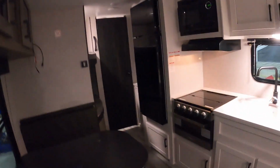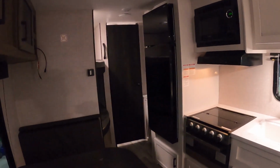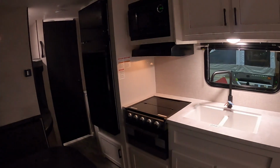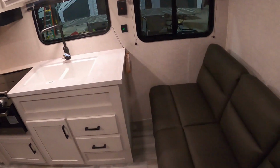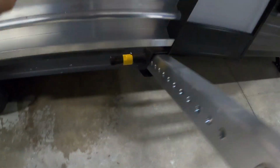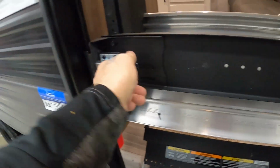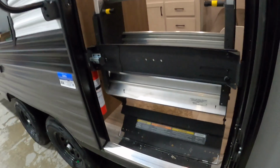But secure everything for travel. Doors and drawers is what I like to say. Go through the unit. Make sure you have all doors and drawers closed and nothing's going to bounce out as you're traveling down the road. And we'd exit our unit. Again, on these steps, we want to make sure this exterior door is all the way open. These are adjustable. Just have cotter pins to pull there. Set this up in there. That'll help lock it in.